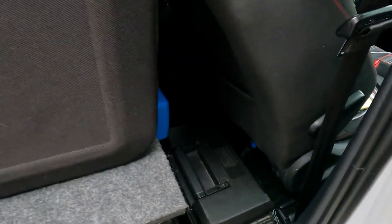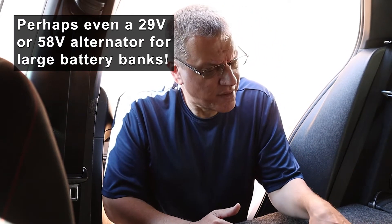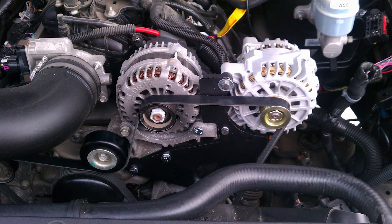When it comes to charging lithium batteries or secondary batteries, most RVs have a secondary alternator as well — that's strictly for charging the house battery. Technically, this is a house battery, although this isn't really a house. A lot of vans, save for small van builds, also have secondary alternators, or it's not hard to add them, but most don't. I'm pretty certain that the vast majority of passenger cars do not have secondary alternators. Comment below if you're aware of a passenger car that has one — it's got to be a luxurious, expensive car. So when it comes to charging, there are three problems with charging a secondary battery without a secondary alternator.